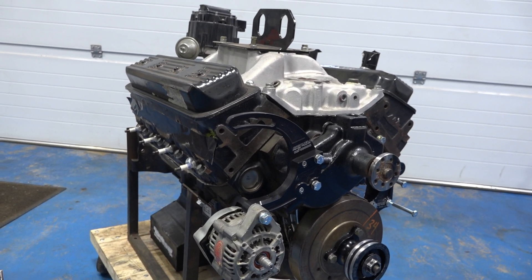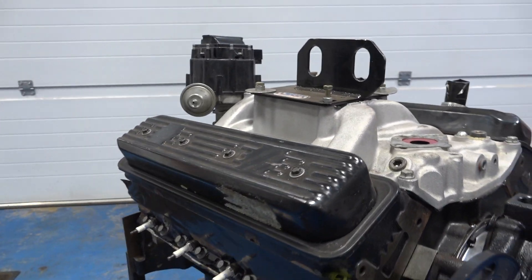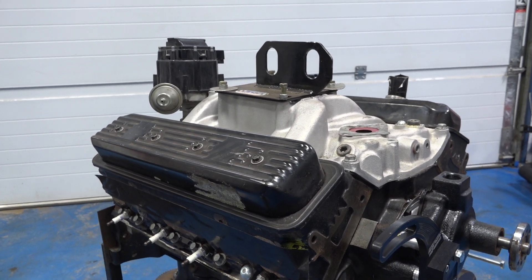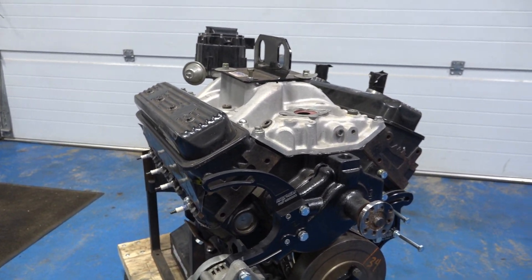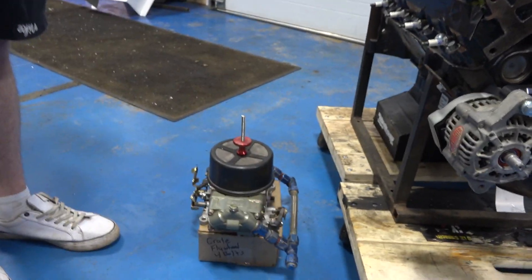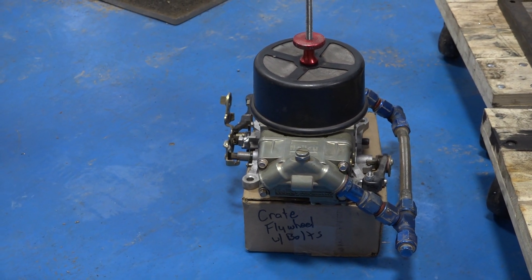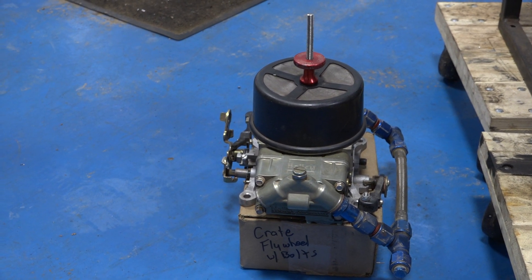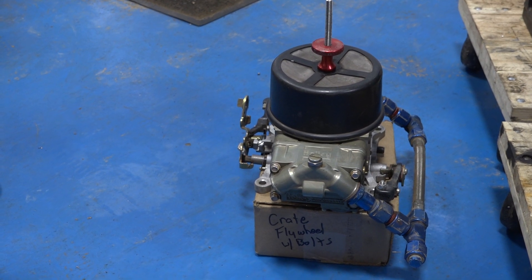I know if you're making 380, that's kind of the number where they say that's a little too much. You saw the valve covers on here — that's how you can tell a crate right away. There's no carburetor on it, but that is just a Holley 4150 650 CFM, and that is our base model carburetor. That's what DIRT makes everyone run, so that's about cut and dry.